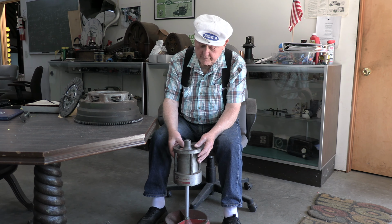And when we do that, the number we come up with, and I apologize to Les Andrews because he has suggested either 5/8 of an inch from this surface in his book, and then later he suggests 3/4 of an inch from this surface. Neither one of those is the most optimum. The number that you want, that is the most efficient number, is actually 0.503 or 1/2 inch down.